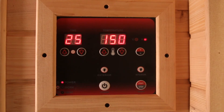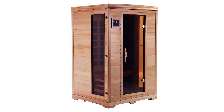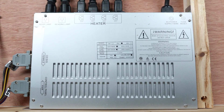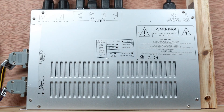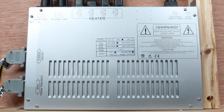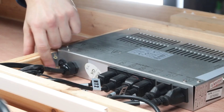If the control panel has other issues such as lights not coming on or buttons not working, the panel may have been damaged and may need to be replaced — contact the manufacturer for solutions. If the entire sauna shows signs of having no power, first check to make sure all power cords are connected, not damaged, and securely plugged in. Next, verify your main circuit breaker hasn't tripped. Then check the power supply box on the roof to make sure it is working properly and verify there is no burning odor, strange smells or sounds, or high temperature. You may need to reset the power supply by pressing the reset button on the power supply on the roof.